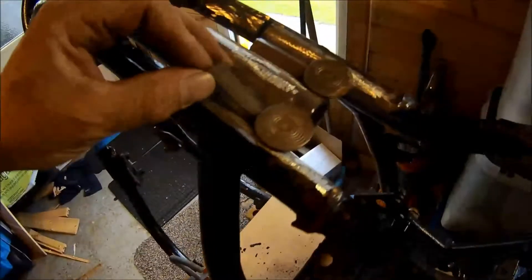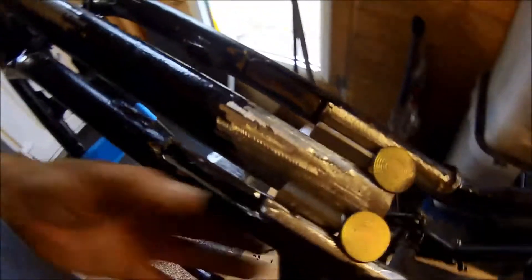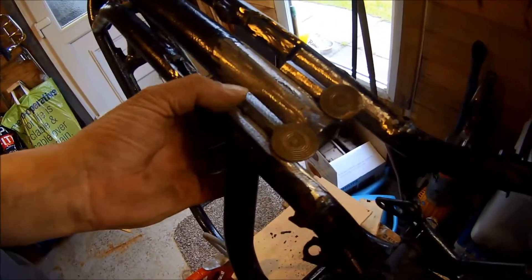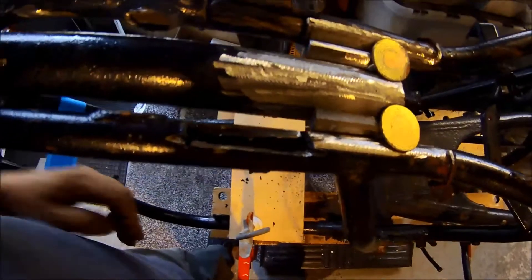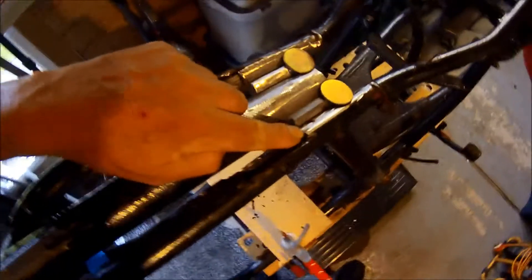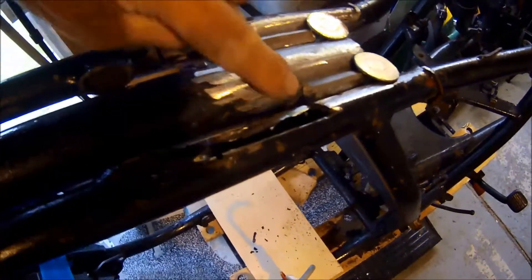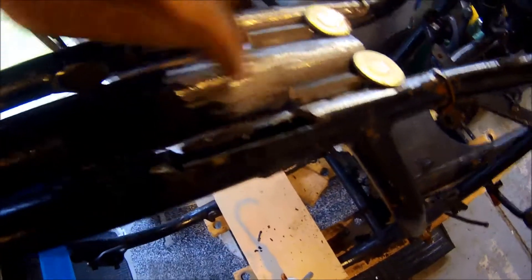And on top of that there are these. I've put a flat on this side, a flat on the top, so I could get a level - a flat on the top. What concerned me was these are a bit difficult, they'll have to be clamped before I weld it. I'm quite happy to put big heavy welds into this because it's so thick. But the original tubing is pretty thin-walled, so I need a flat against it otherwise I'm going to burn through. That's why there is a flat there. But it'll have to be positioned exactly right - it gives me loads of contact on this, but I need more contact so I can run a fillet there, there, and underneath. And I've not cleaned it out enough underneath - there's still paint on that. A bit more work to do.